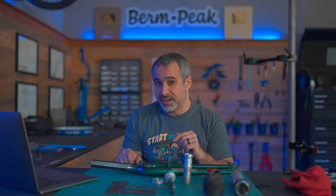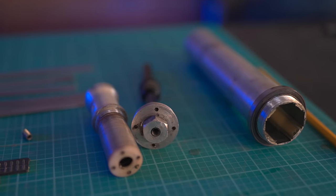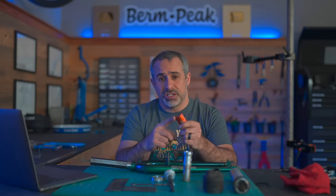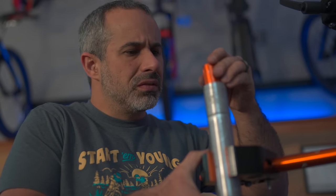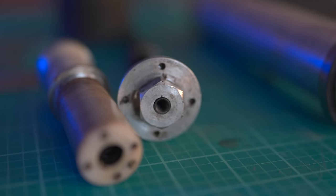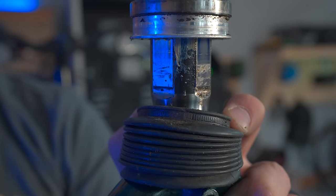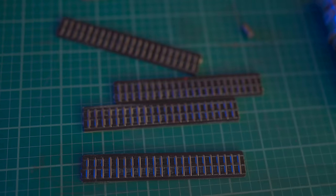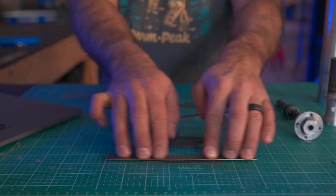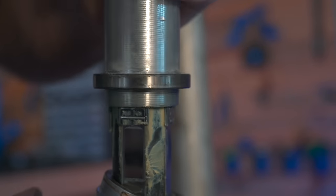Most people back in the 90s would have taken their head shock to a Cannondale service center. I bought this head shock on eBay so I could attempt to take it apart — it's missing some parts, but you can see this castle tool is one that you would have had to buy, and it was able to come apart with very little resistance. Now that I have all the parts out on the table, I can see that if you knew what you were doing it wasn't that big of a deal, but it looks really, really intimidating. You can see this round shaft with flat spots cut into it, and these flat pieces of metal were the bearing races. Each set of needle bearings is kind of a cartridge — just a sheet with rollers on them. When these would migrate, you'd have to hold them in place and top out the fork to reset their position.